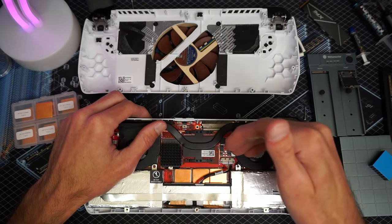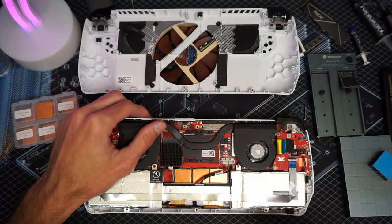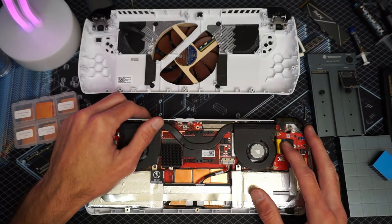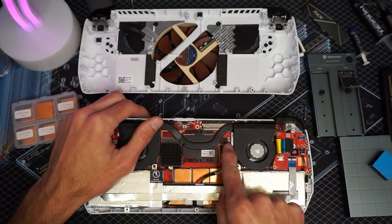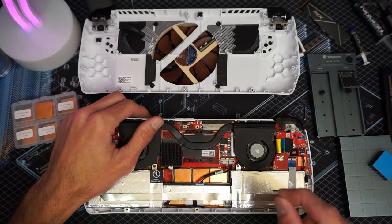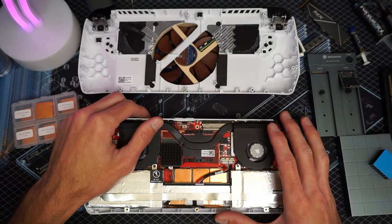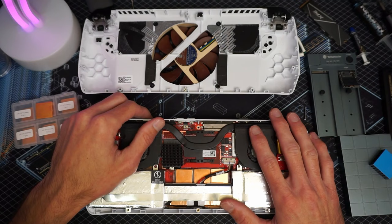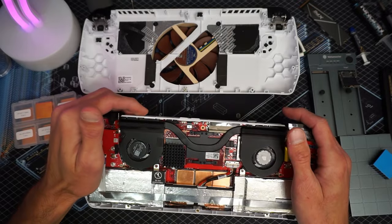The more efficiently you can remove heat from this board — either cool it or exhaust it — the better off you'll be in the long run. The reason Asus raised the fan curve over here is because they knew this area was extremely hot and at lower fan RPMs it was not exhausting the heat out. So the heat was essentially just soaking into the board and eventually onto the other side where that chip is. Asus noticed they probably needed thermal pads on the back of the MOSFETs and inductors. This little metal part right here is actually part of the fan housing, and on the other side is the power delivery — and there are thermal pads under it. We're going to get into this guide in the next video.